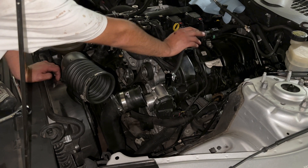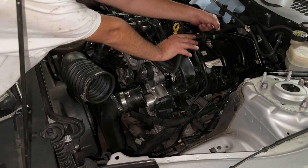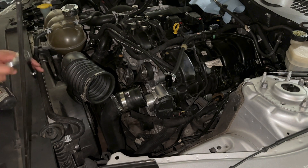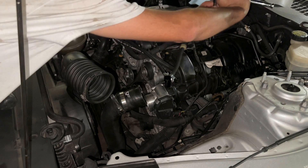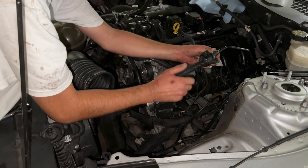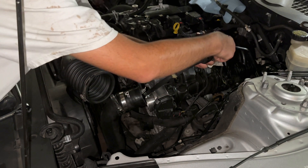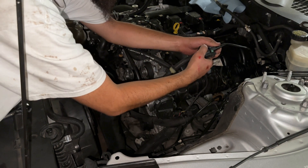I'm going to start taking off the purge solenoid. The purge solenoid right here on the top has a connector that you've got to push in and pull out. There's a 10mm bolt that sits right here and holds her down, so take your 10mm and stick it on there going in the right direction. Most people have problems taking these clips off, but they're really easy — just push them down and pull out. Push them in and it will pull itself out.